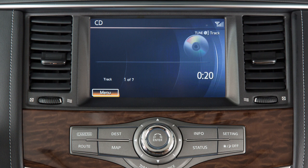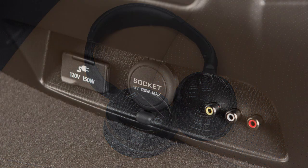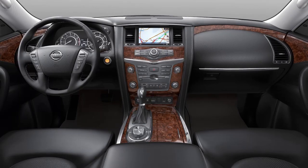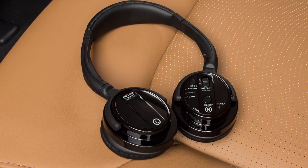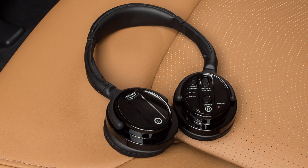Change the front display to any desired audio source and it will play out of the vehicle speakers. The two headphones will still be set to the DVD source. Connect an auxiliary device such as a camcorder or portable video player to the rear auxiliary jacks. Slide the display select switch on the remote controller to the right and press source to choose the rear aux mode. When complete, the front passengers can listen to an audio source through the vehicle speakers, the left rear passenger can watch a DVD and listen through the headphones, and the right rear passenger can view an auxiliary source while listening through the other pair of headphones.